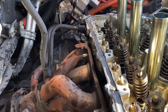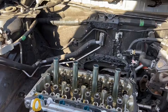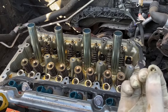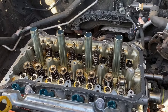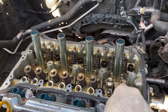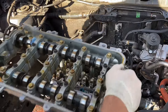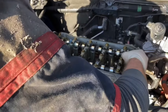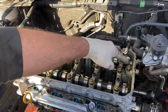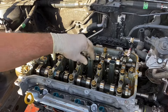Before we put on the cams, I recommend doing the exhaust — it'd be a lot easier now. Don't forget these 12s you took off, just put them right back on now. Remember before we put these roller rockers on that all of the valves still have these valve stem caps — that'll prevent ticking and allows these roller rockers to sit on properly. When you put these on, make sure you put them on straight, not at an angle. Now we have all the rockers in, the silicone bead is down — we're going to put the valve train, the cam assembly, down. Line it up nice and straight before you drop it down. Tighten up all of these 12 millimeter bolts except for the ones on this row — not these three because that's the holders. Start with the centers and work your way out so it goes down evenly.